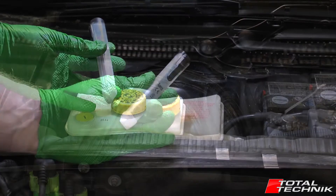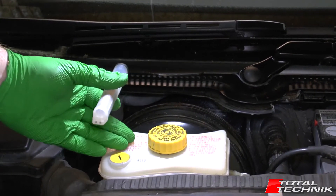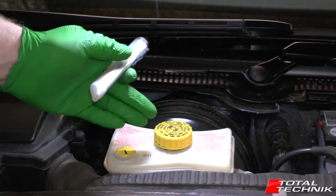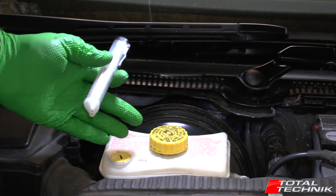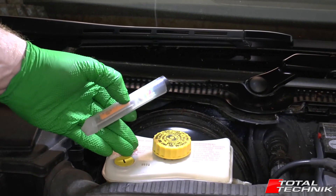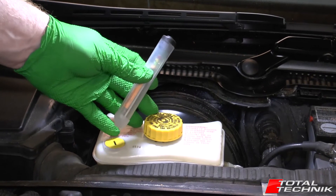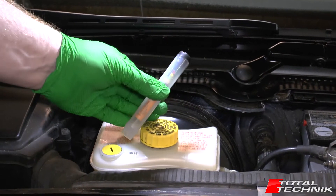So take a little look at how these work. The basics on the principle of how these work - what these do is they measure the quality of the brake fluid. Now the problem with brake fluid is it actually soaks water in from the atmosphere, and likewise it will soak water in from any kind of leak on the system. So over time you will inevitably get water into the brake fluid system, which is why you have to change the brake fluid every once in a while. This little tool will measure the percentage of water contained within your brake fluid. It's got three little lights like a traffic light - a red, an amber and a green - and it will show you the quality. Obviously if it's showing too much water in it, then you know the brake fluid really wants to be changed. It's a good handy tool and quite inexpensive, so well worth getting.